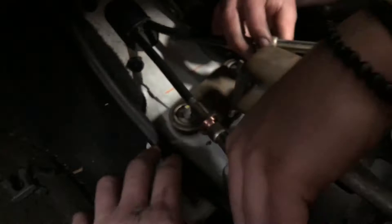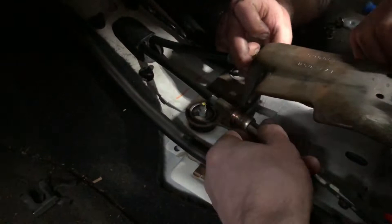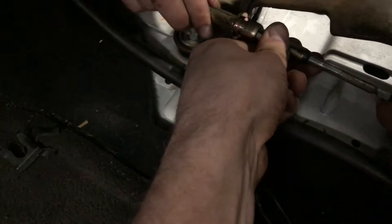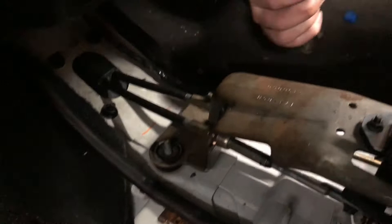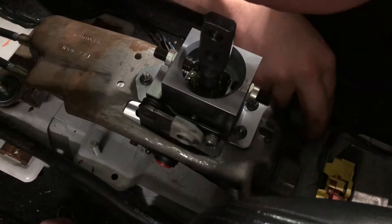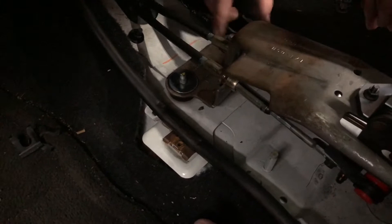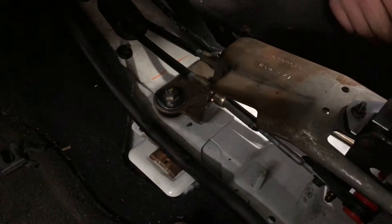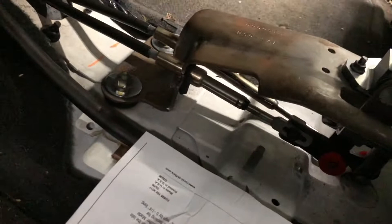Once we get the cables back in we're nearly done. Slide the base forward a little bit — there are four washers that came with the kit that go over the studs. Those allow the bolts to hold the base down again. All the nuts go back on each stud — 105 inch-pounds for all you torque-specific people. Both shifter cables are now attached.